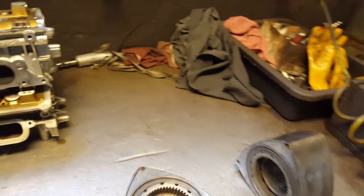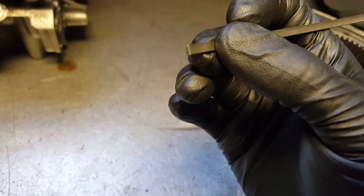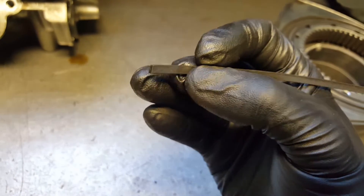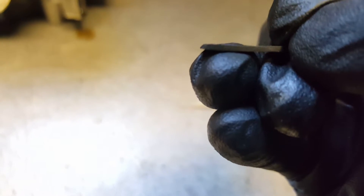And then a quick tip: whenever you guys are ready to assemble the rotors and you already have your side seals, let me show you something — the little angle you have to give them. This is how the side seal is gonna look when it's brand new, and you're gonna have a little stone and then we're gonna file it down to give it a little shape. You see that angle right at the end? I know you guys can see it — it has a little angle.